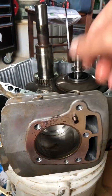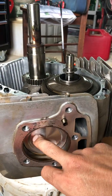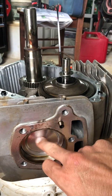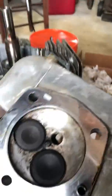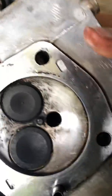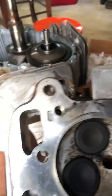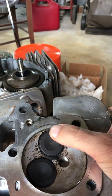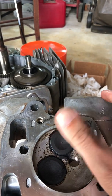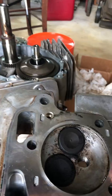This is our cylinder here. As we turn the engine, the piston is coming out and back in. There will be carbon buildup — mine had a ton of carbon buildup after 300 hours. Carbon buildup on the piston head is not necessarily bad for combustion, but more importantly carbon buildup on your head is a problem. When that rocker arm pushes down on that spring, it pushes this valve up, letting the gas, air, and fuel mixture in. Then this other valve pushes up, letting the gases out. And your spark plug is right there, igniting everything in this little tiny combustion chamber.